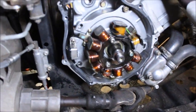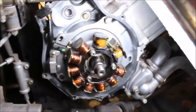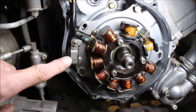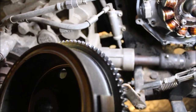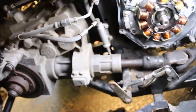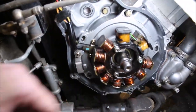My first thought was it was the pulse coil. So if you've never pulled your stator off, this is your pulse coil. When your flywheel spins around — actually, let me show you the flywheel. This is one really clean flywheel. There's a little plate that sticks out there, just cast into the flywheel. Every time that passes the pulse coil right here, it tells it when to spark.